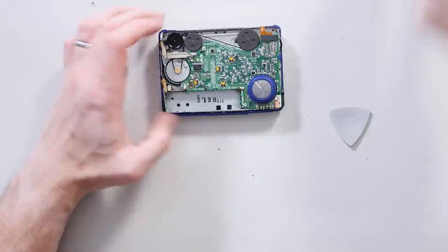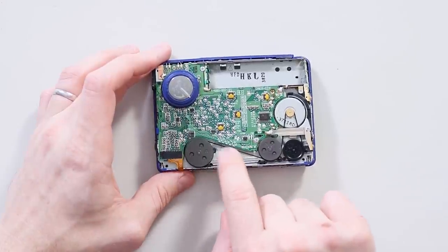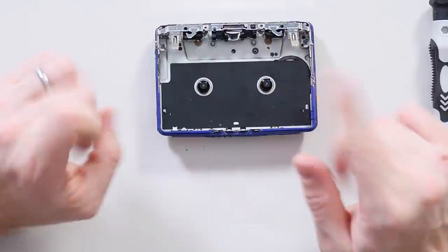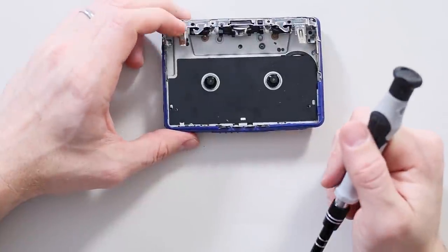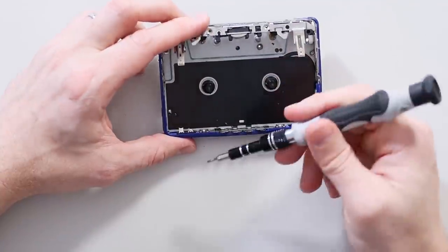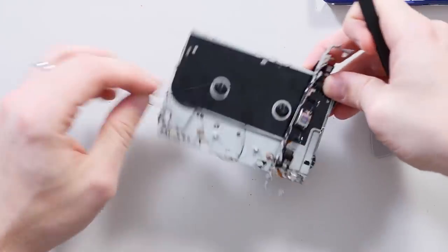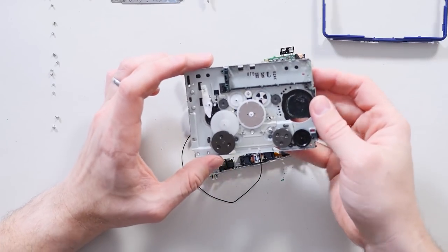Belt drives. Single motor, which presumably isn't multi-directional. Actually, that still moves wonderfully — the belts are getting on for 20 years old and have a fantastic feel. Up here we've got a couple of tiny little switches that interface with the bottom of the tape, telling it what kind of tape is in there. That's the direct replacement for the buttons which told you normal, metal, or chromium. Those two notches could mean either chrome, metal oxide, or ferrite — the three options — so this would know automatically which kind of tape was in there. This big thing here is a sticker, and that's released the motor and with it the motherboard.